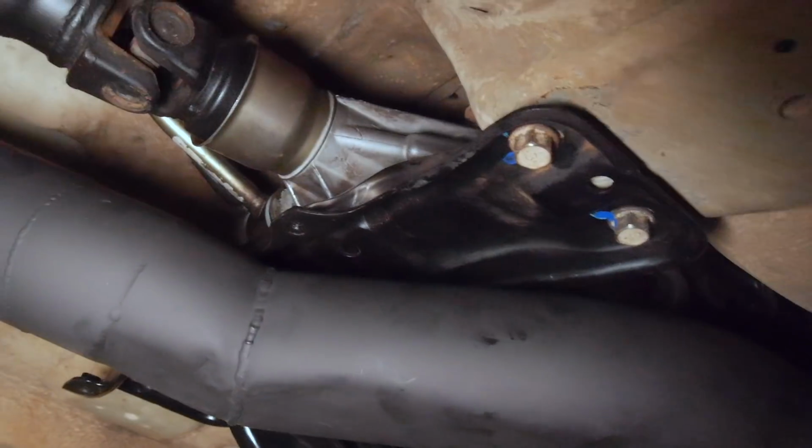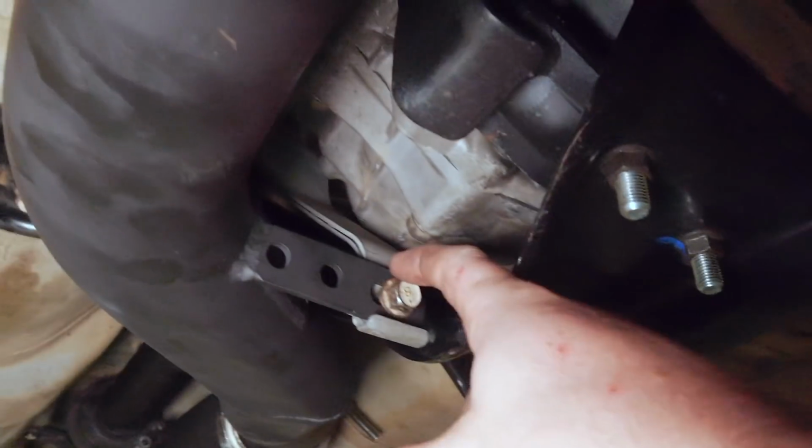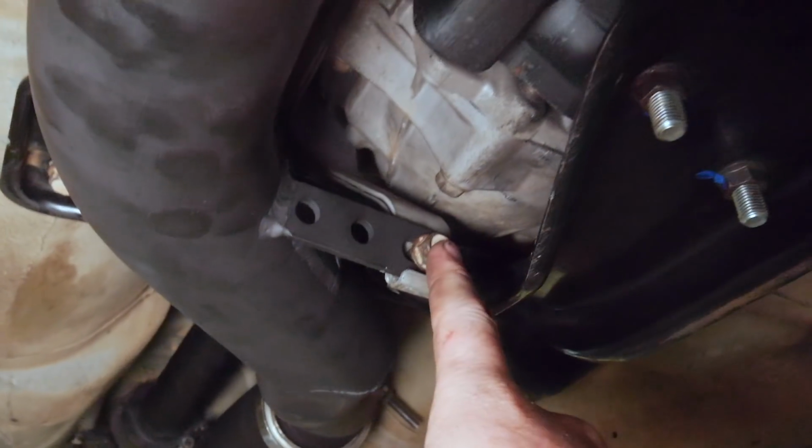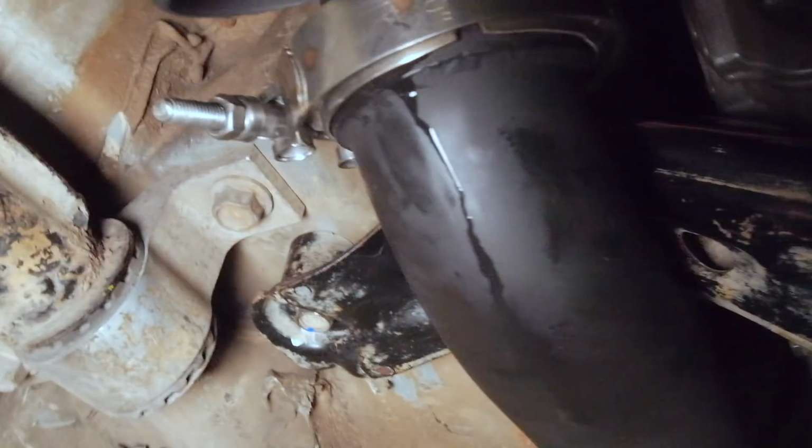Down through this mid pipe, as you can see I've got it all tucked up as close as possible. Like there's a finger gap there. I'm using the factory STI hanger. I think most of the Subis come with this little hanger there, so that comes in handy. You can just hook it on and then hook all your V-bands up. It's another thing, V-band connections everywhere.